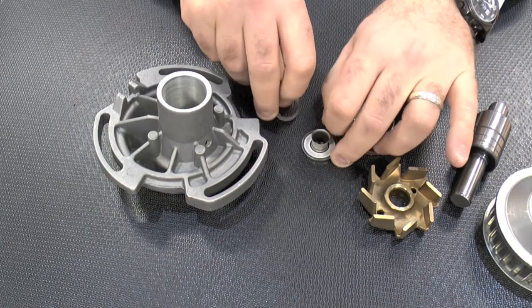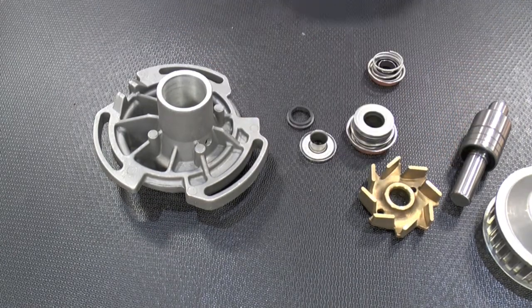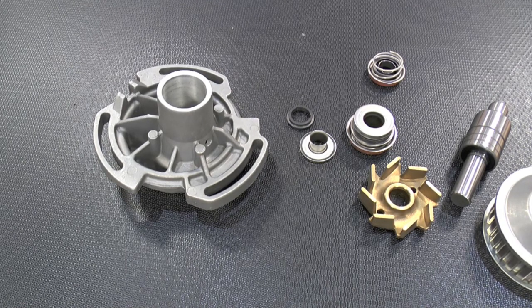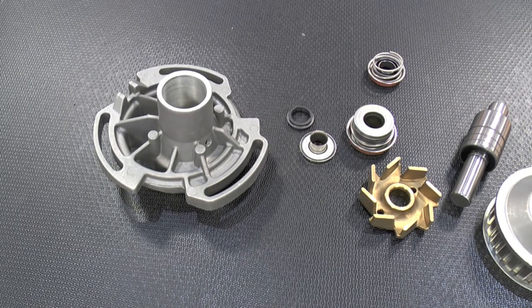In certain instances, a phenomenon known as stick slip can occur, which leads to noise at low engine speeds such as whirring or whistling noise. This may be the result of initial dry running on installation of the pump or increasingly by the use of harder carbon materials in the manufacture of the seal slip ring. The use of this harder carbon material in the seal slip ring, however, has greatly reduced the frequency of leakage.